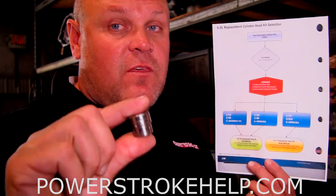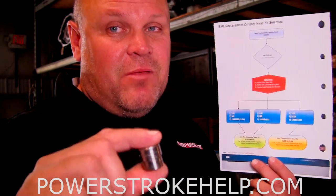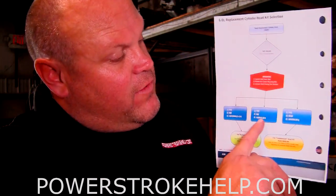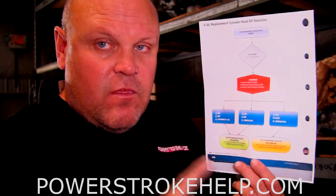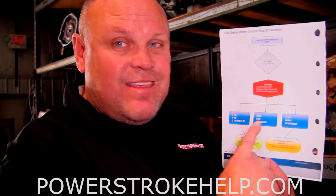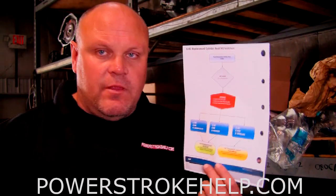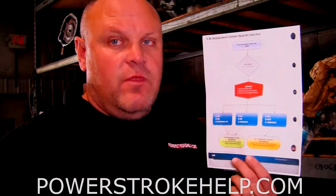You can actually use this same step-down to put an 18 millimeter head on a 20 millimeter block — I've seen it done lots. You have the same part numbers over here, but the commonized one actually has different hold downs and a different rocker box, and this is where it gets sticky. It's the same part number but you have to look at them to see if you have the ones like the 18 millimeters or the later model ones. You didn't really see this until about late 2006 and into 2007. Ford continued to make vans all the way up until 2011 with the commonized motor and that cylinder head.